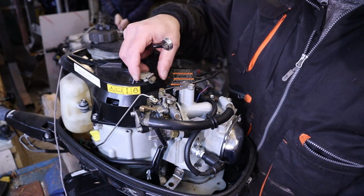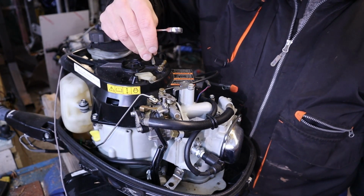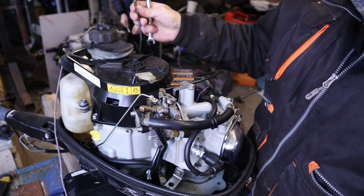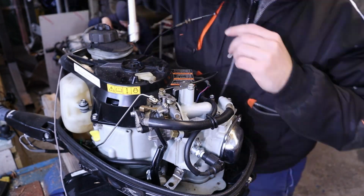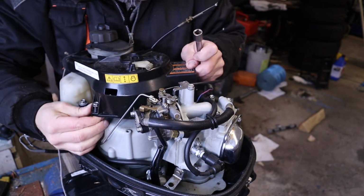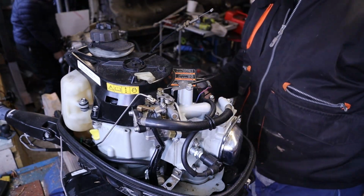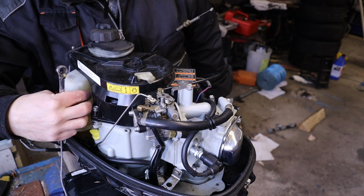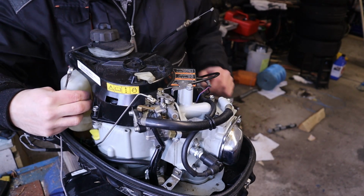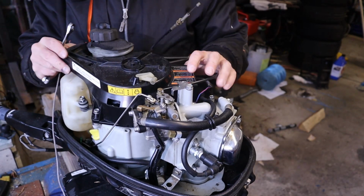Take the assembly away. You need to loosen the gear cable. There is a spring. Put it in neutral, and so you can pop it out, and then loosen this 10 millimeter nut, and the cable comes off. It's also necessary to take the tank loose, so you can get a little bit more room to play. Maybe.